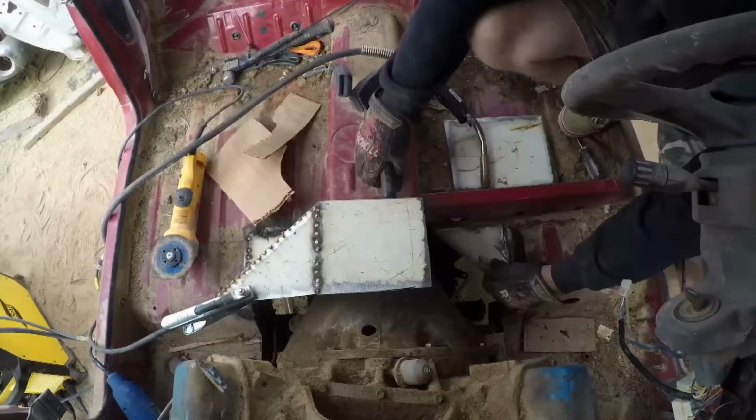That's spark. You gotta be freaking kidding me! We have light! Whoa! I knew it would fire up instantly. It's got a Thermoquad. Honestly thought there was almost no possibility that all those used parts would work. And, I mean, the magnetic pickup could be junk, that ECU could be junk, the ballast resistor could be junk. Yeah. Do it again, see if you have oil pressure.